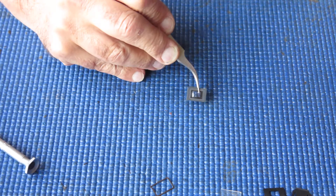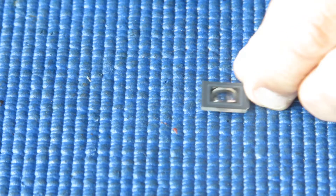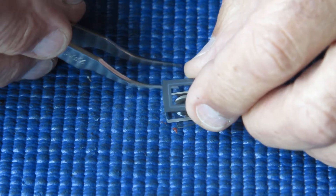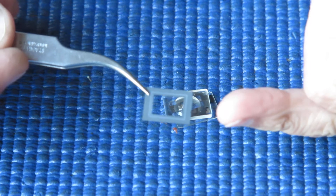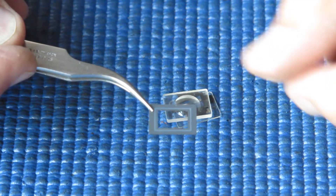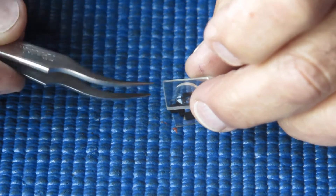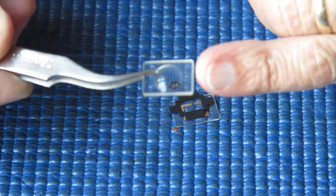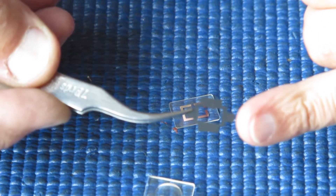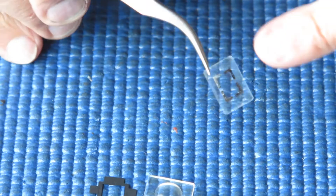I've lifted them out as a piece — that's good. At the very front we have a plastic mask with the small parallax correction marks, so you know when you're up close that you need to point the camera down a bit. Then we have the front lens — fairly dirty but nothing like as bad as that rear piece of glass. Behind that we have a mask, and then a piece of glass with the silver frame lines on it.